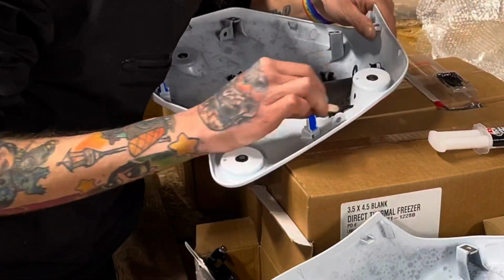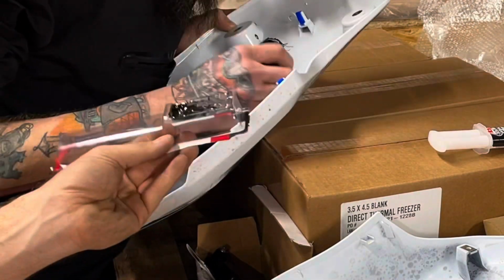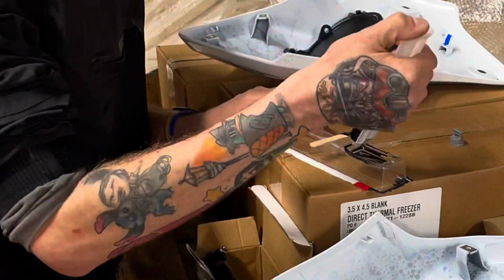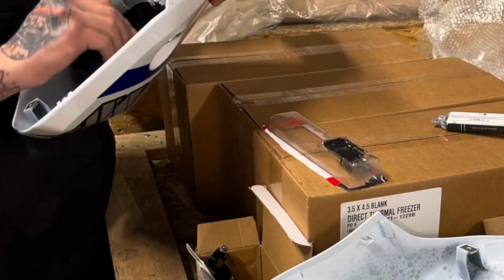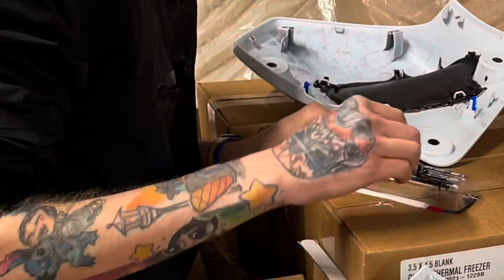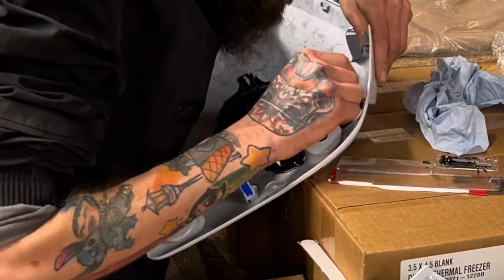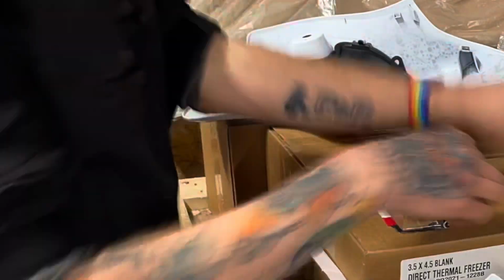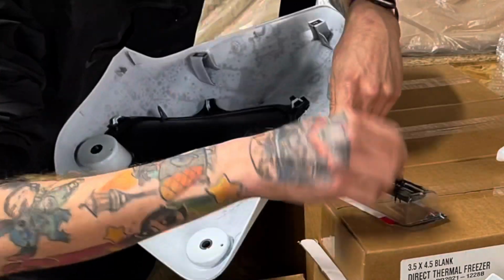Quick set 15-minute epoxy. And we mix a little bit, put it in, and fit it all the way around the seam. And then we mix it another little bit, put it into the seam, and smooth it all the way around. And we continue this process for the entire panel. You may have already surmised this, but it is a 2-part epoxy. You have 15 minutes of work time, probably a little bit less depending on temperature and heat and everything. And it's important to only mix what you need in that moment. Put that into the seam and have a bond, nothing more.